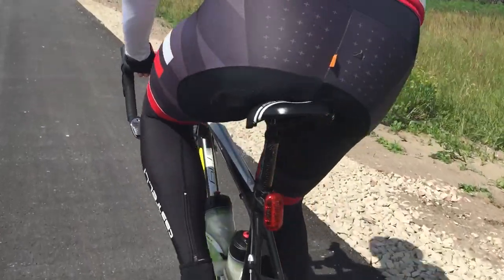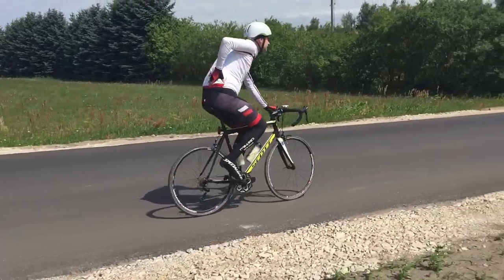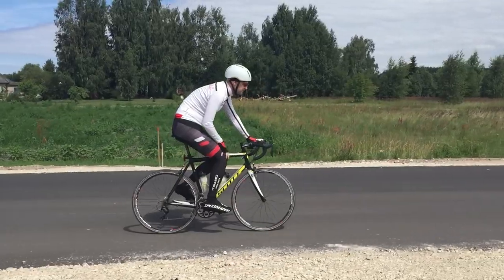Saddle height is an important value in getting a comfortable and pleasant ride. Saddle height can solve physical problems. A proper measurement may exclude issues like soreness, low back pain, pain under seat bones, pressure in the sensitive area, and knee pain.